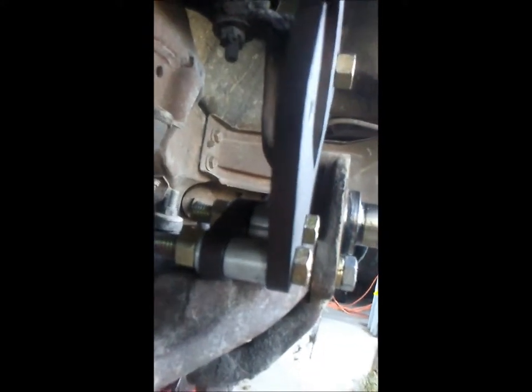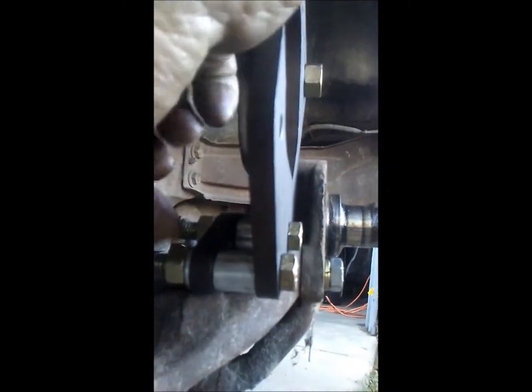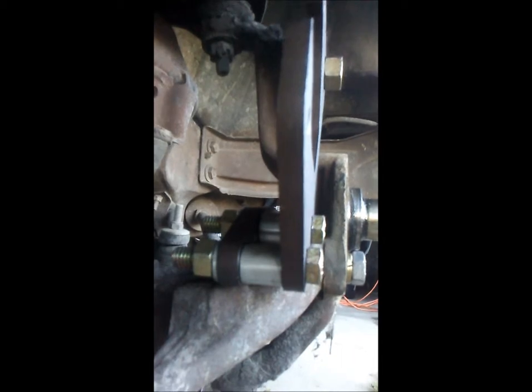You can see those spacers — there are smaller spacers and bigger spacers. This one here had the smaller spacer. You've got your bolt going through here, then a spacer, then your bolt on the end. On this side you've got the longer spacers, so you have your two bolts through here, two spacers, two lock washers, and nuts.